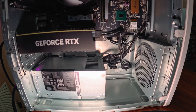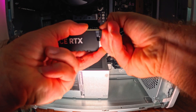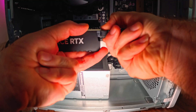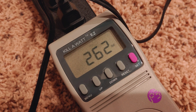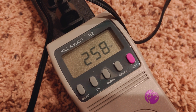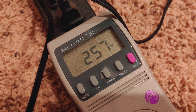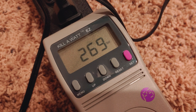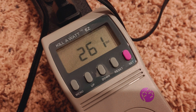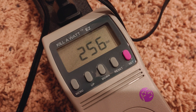What I wanted to show in this video is: if you are keeping the existing 400-watt power supply inside this computer and trying to use this GPU, what your expectations are gonna be. I'm gonna show you the peak power wattage it's pulling from the wall. When you have this GPU inside, the highest I've seen is about 280 to 290 watts. You might think — 290 watts, that's about 300 watts, so you have 100 watts of reserve in this power supply. But the way this power supply is designed and the power is channeled through the different outputs, the 8-pin PCIe cable is not getting enough amperage.